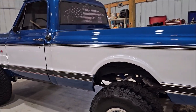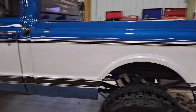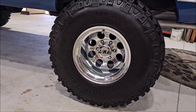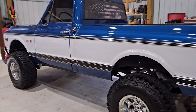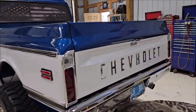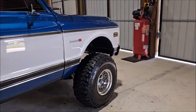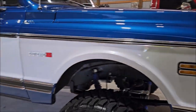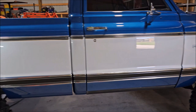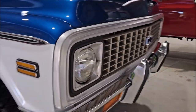Smart Cut always cut great and always finished great — so we've improved upon that. Tires look awesome — super happy with the way the wheels and tires came out. I cut with Smart Cut new version for 2024, finished with Smart Finish on a red pad. Then I went around with Amplify Prep Solution — my prep solution that will prep for protection, but it also leaves behind a primer that allows you to get up to 30% more durability and longevity out of your protective products. Super awesome benefit of just using that for prep.